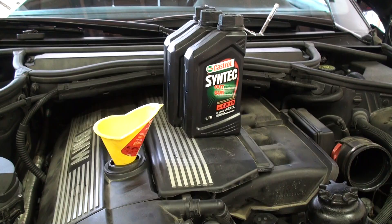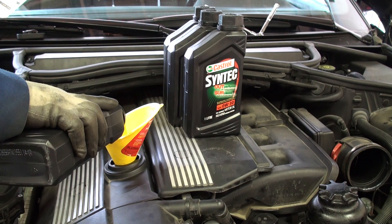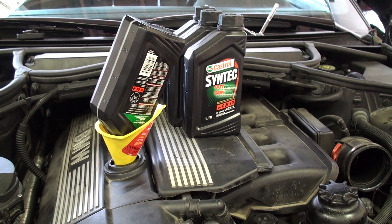So up to this point, we've replaced the engine oil filter, the oil filter housing O-ring, and the copper crush washer on the drain bolt. Now we're going to fill this engine with engine oil. I'm using German specification Castrol Syntec 0w30. The reason is that where I live the climate is very cold in the winter, and the 0w30 allows the vehicle to start easier and offers more protection during cold start-up. BMW recommends Castrol Synthetic 5w30, but the 0w30 gives better cold start-up performance in minus 30-plus centigrade temperatures.